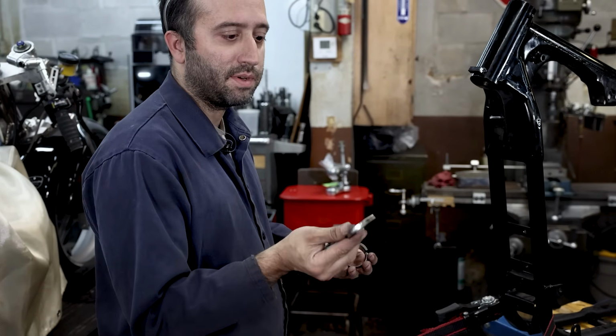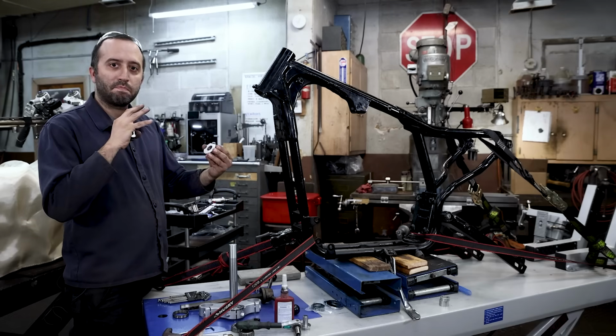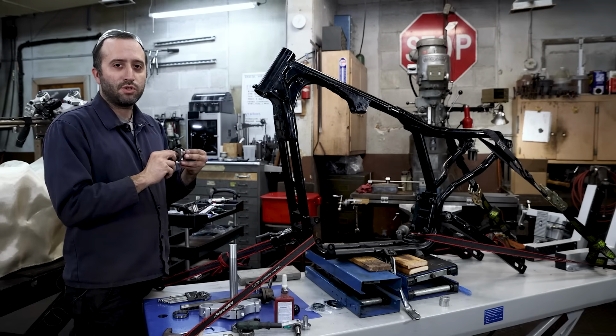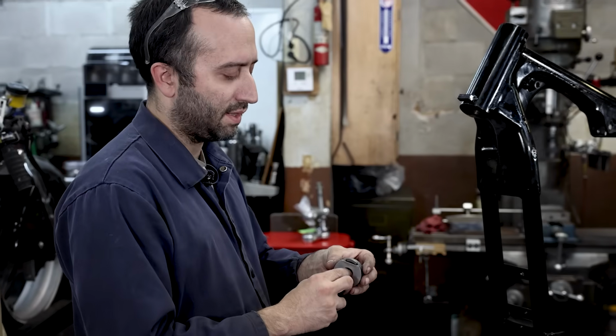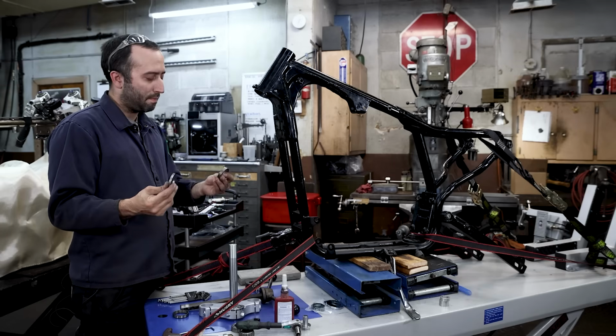You'll have to have some type of relief for the fork stop, and you want to engage basically as much of the outside diameter of the race as possible to ensure that it pulls in straight, parallel to the neck when you're pressing this in. So you'll be able to find this on the website. So just keep that in mind when you're pressing this in.